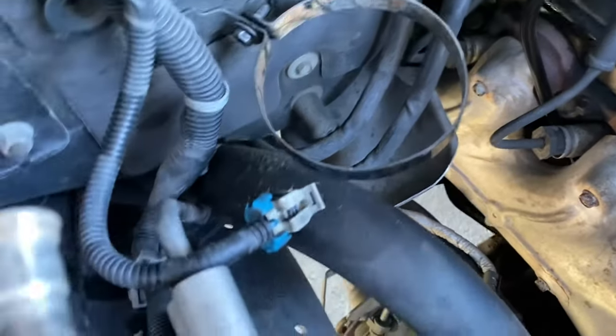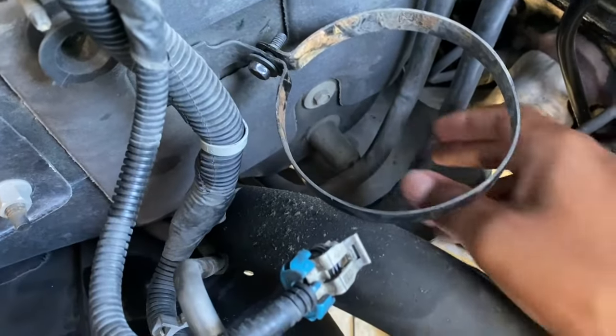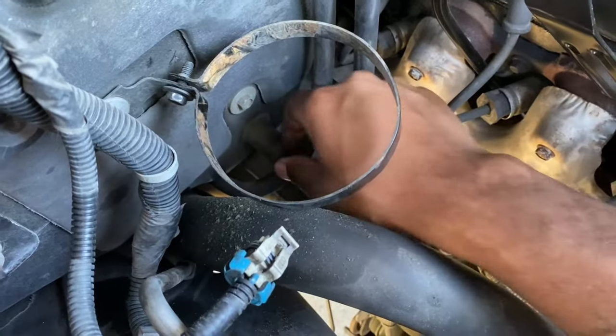While working on my AC, I noticed the drain for the evaporator was not facing down properly — it was dripping down onto an electrical connection. So be sure that the drain faces down towards the pan so it can drain correctly.